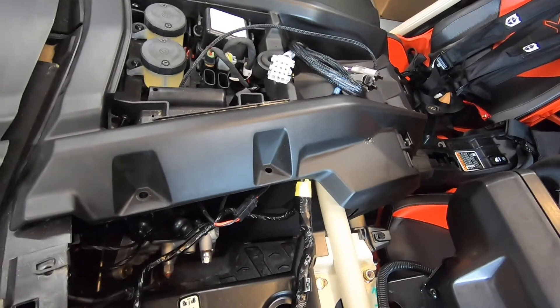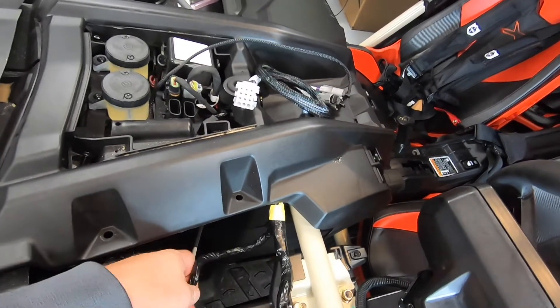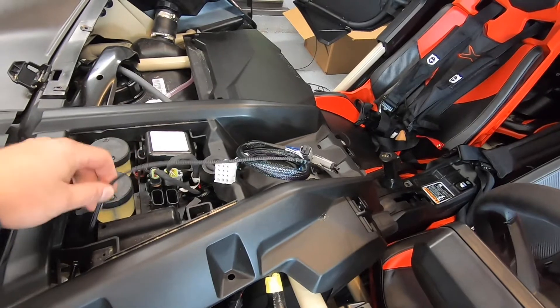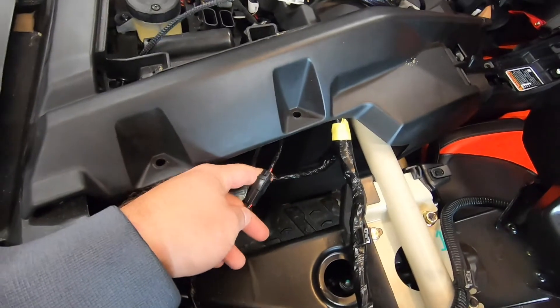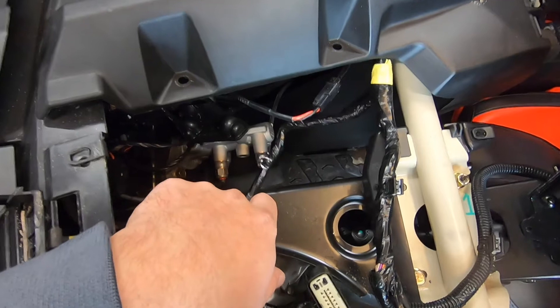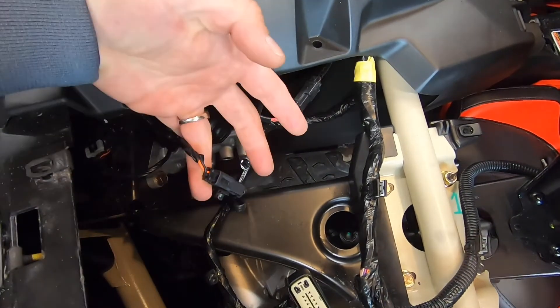In their instructions and in the videos online, it shows you to find the wire harness — specifically the head unit wire harness — by going through the dash and finding the power wire. The power wire is actually not attached to any of the harnesses like they show in the video. There's a similar plug you really shouldn't unplug. Underneath the center of the dash, there's actually a white dummy clip attached right there, and the accessory power cable is plugged into that dummy. All you have to do is unplug it from there and you have the accessory wire they're talking about.